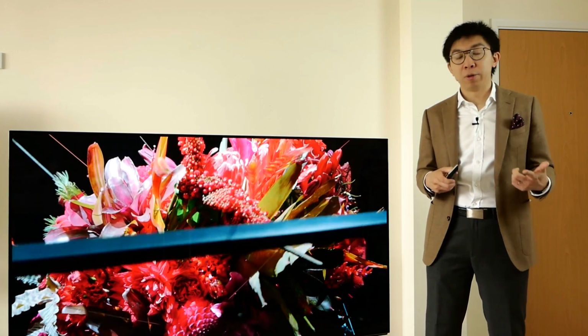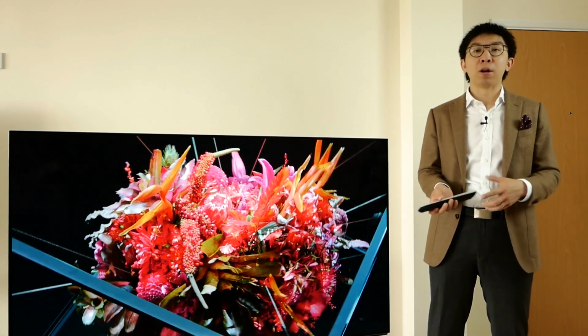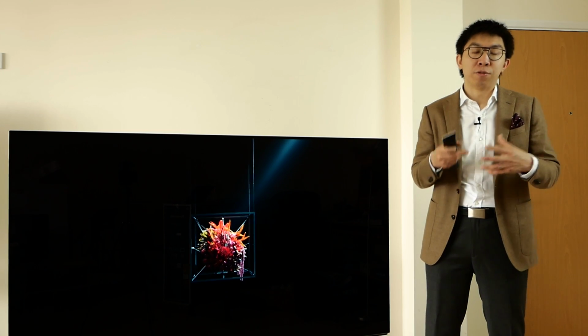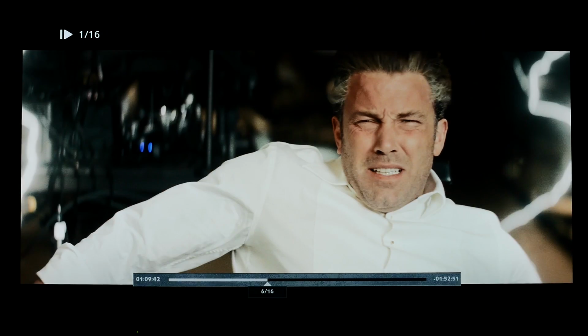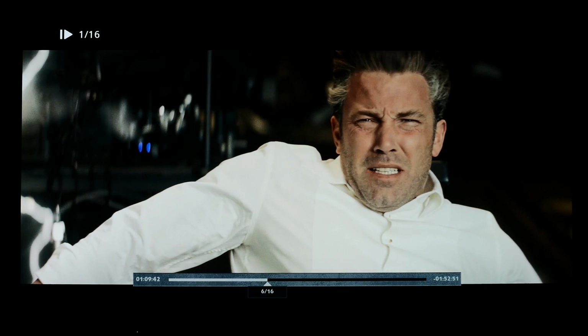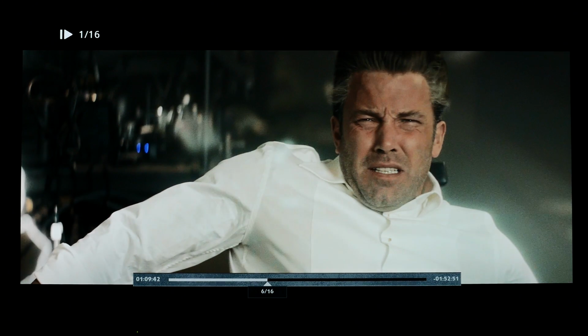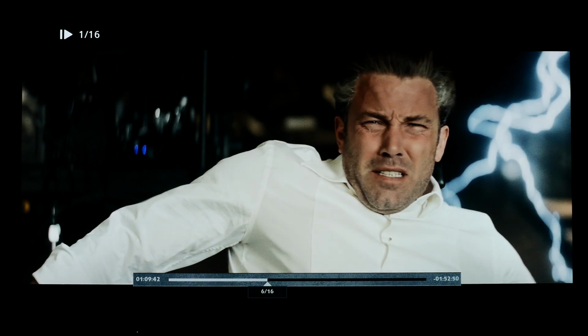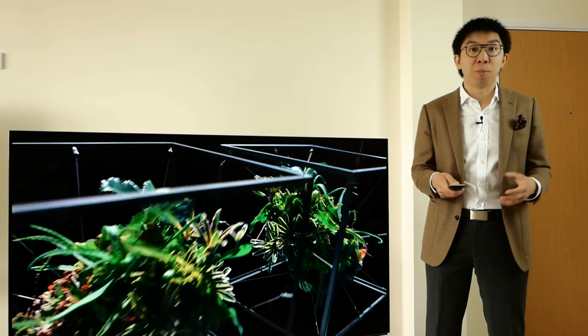And then I really like the HDR tone mapping approach that is used by Panasonic engineers as well. I think they've done a fabulous job that strikes the best balance in retaining enough brightness and detail, especially in 4K Blu-rays that have been mastered to 4000 nits, all without introducing any excessive posterization. And the third thing is the motion.